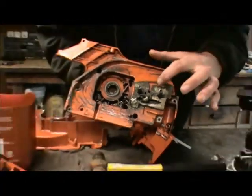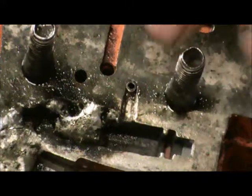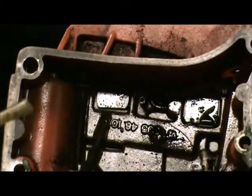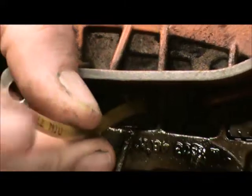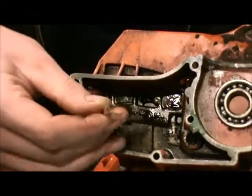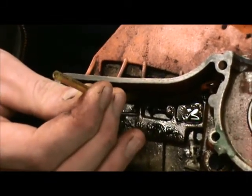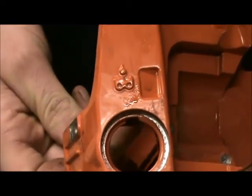So this is a 394 case — this is my old case. That is a 3.6 millimeter hole with a steel tube, dowel pin, whatever, pushed through it. It comes out the back here where this piece of melted tube was at one time affixed to this piece of pipe and curved up to the top. What we want to emphasize is that piece of tubing — you don't want the tubing down or over like this. You want it straight up with a little bit of a curve to the top of that fuel tank. When looking at it from inside the hole, you want it up in this corner right here.